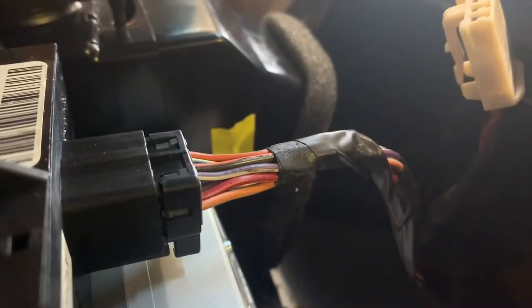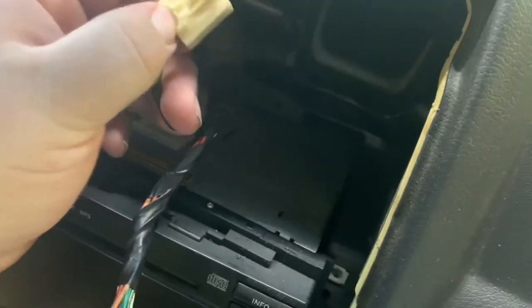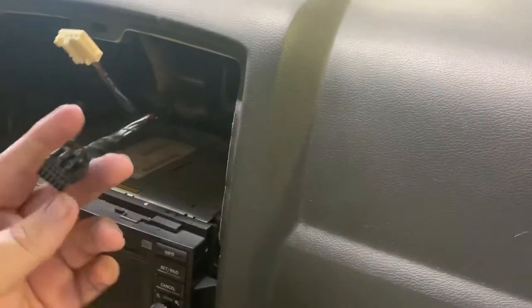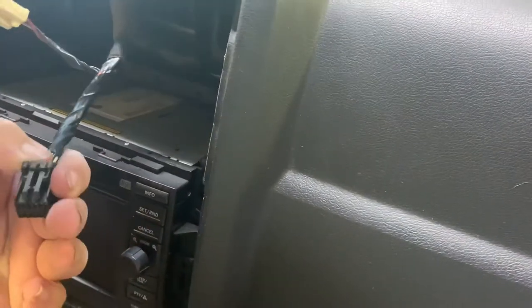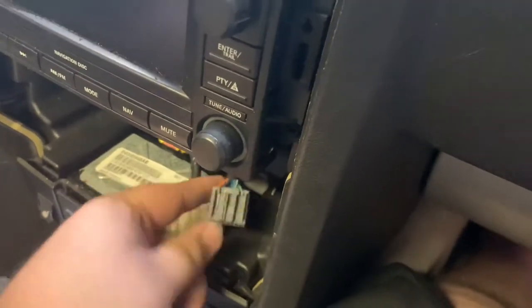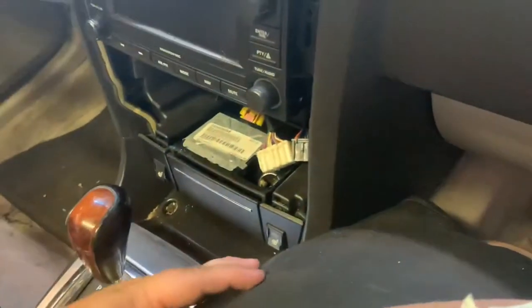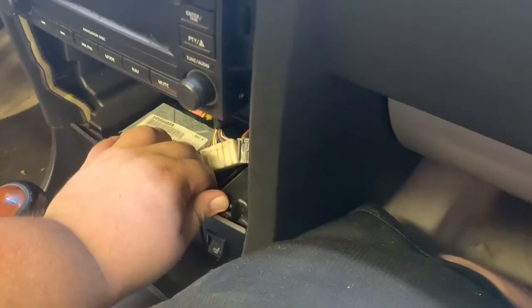Here's a trick: these plug-ins right here - you push the tab in the middle and they come out, then you can take this out, flip it upside down, and get to the lower plug. That'll make your life a little easier. On these plugs, this one goes like this - you can stick your finger underneath and pinch it right here and pull it out. The other one you have to push right there on that little tab and pull it. For the ones down here, squeeze the tab in the middle and they pop right out. Now we're going to move these guys, push them off into the dash out of the way.